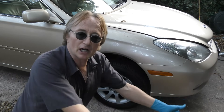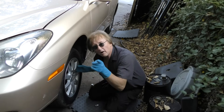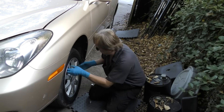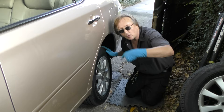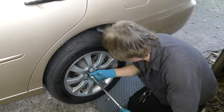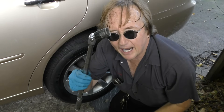So we're going to swap the tires back to front, that way we can tell if it's the front tires that are making the wobbling. I'm switching the left side to the left side and the right side to the right side, because many tires are unidirectional and you always want them turning in the same direction.